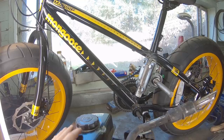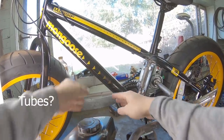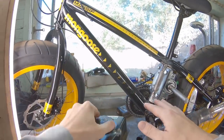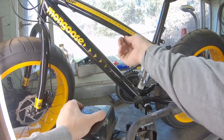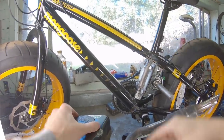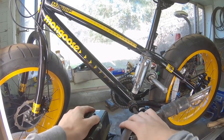Our next step is fitting up the frame so we can put this engine on. I'm thinking I'm just going to do away with this top bar. I'm not going to mess with the bottom bar because our gear shifter cables are down there, and I want those gears to be working just as stock. On the other hand, this is just the back brake, so I can deal with modding that up. I'll start out by cutting this and see where we get.